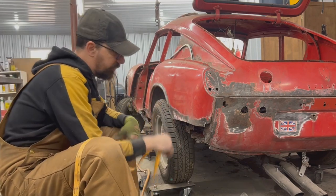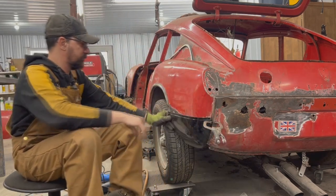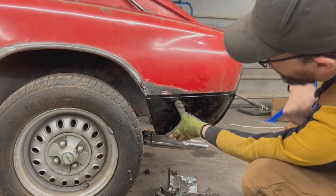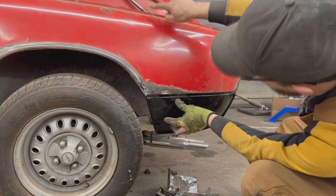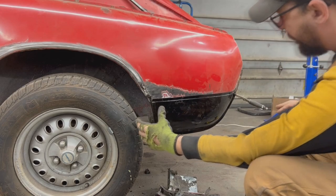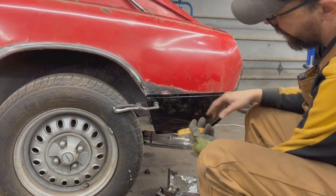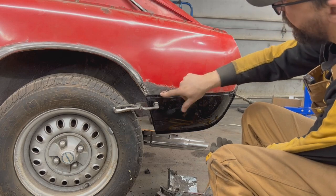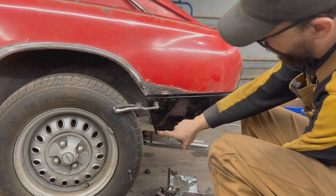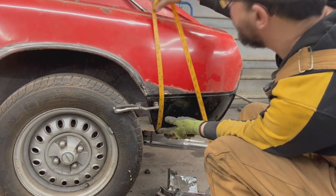Note to self: if you want your mark to stay, first de-rust and then mark, not the other way around. Okay, so now here there's not much that can go wrong, I'm pretty sure it is somewhere here. I'm gonna measure from here to here and compare it to the other side just to make sure that they are the same — 19 and 3/8. So here of course we have to measure around the curve, and this is overlapping too high so it's going to affect a little bit. I measured from this corner to this corner and it was 19 and 3/8, in a vertical line.